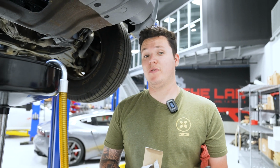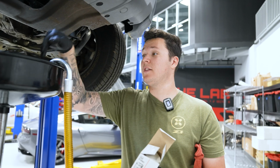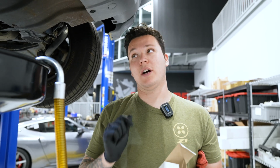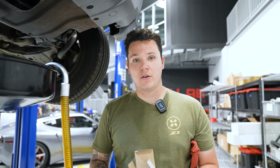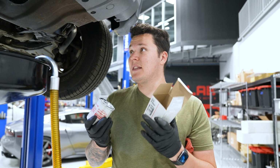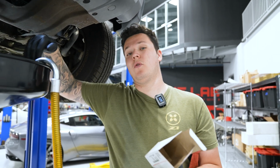So before we do our oil filter, you will notice that the factory has placed a small little spout for the residual oil to drain off into the drain pan. However, this can be a bit of a messy job as the spout from the factory just isn't quite long enough. So what you can do is use a bottle, which we've shown in previous episodes, or you could even just use a bit of cardboard from the supplied oil filter cardboard, and just use that to essentially guide the oil further out from the spout provided into your oil drain.